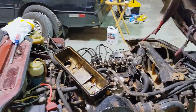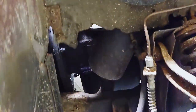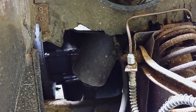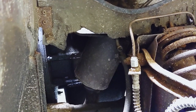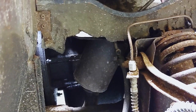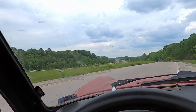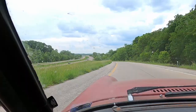The other drivability issue — there it is — that's a catalytic converter. I'm kind of shocked to see that because I wasn't really aware they were doing cats this early. If it's still got converter material in it and it's been running rich, that could be part of the reason we don't have a lot of power. I realize Spitfires don't have a lot of power to begin with, but this one doesn't have much at all. Between a vacuum leak and a clogged catalytic converter, that could explain it.